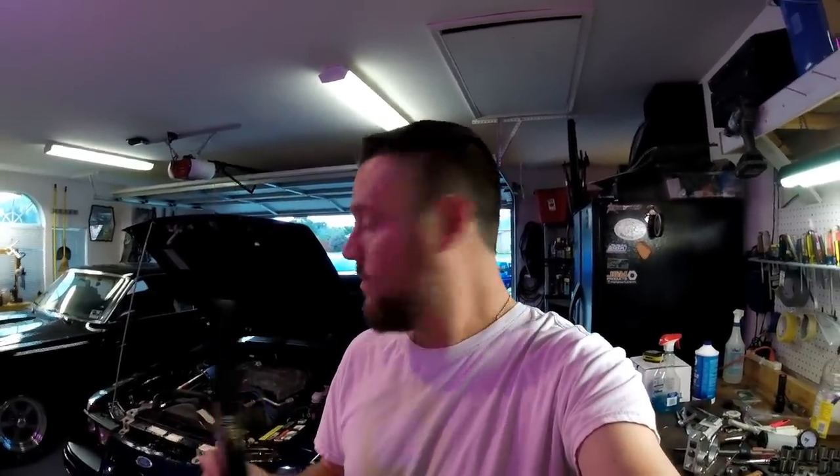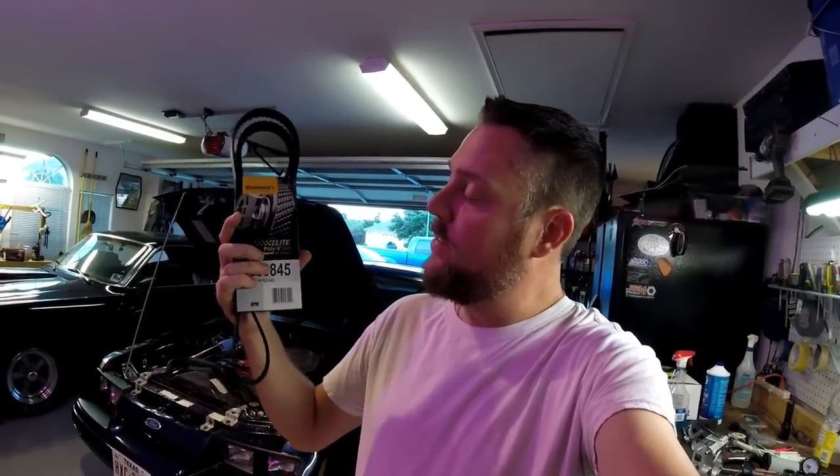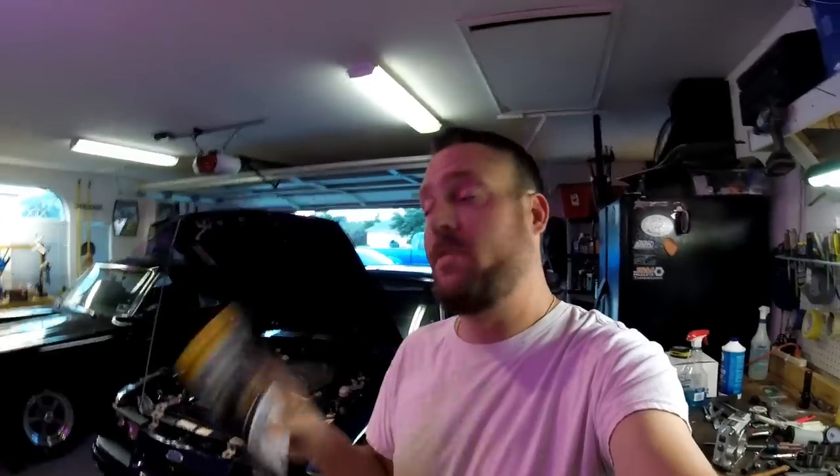The way we're going to do it is reroute the serpentine belt - you can get rid of the pump without adding the bracket. That just adds more space and fills a void with another pulley; this completely eliminates it. We're rerouting with a shorter belt. I did my research and the belt part number is 4060845 - most have the same first numbers. The 845 means 84.5 inches long. The stock length is about 90 inches.